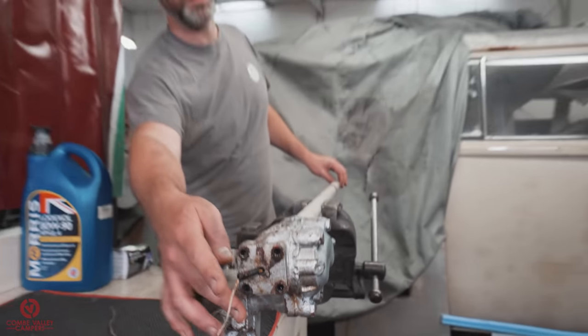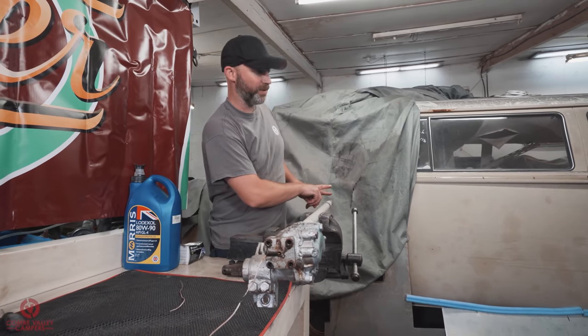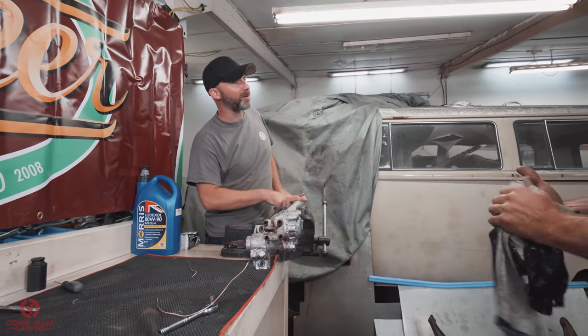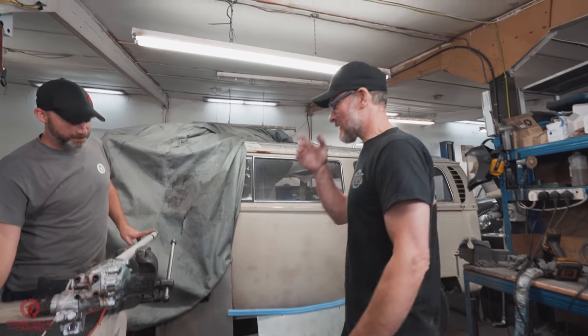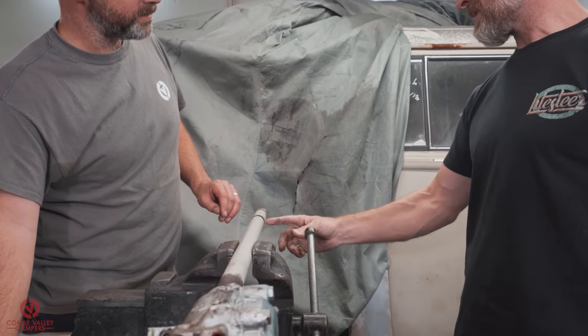So we're not actually going to replicate that, or we are? No, we're not, because your kit sits halfway up. But it's the fact that it's earthed from that horn push to the body of the motor, and then the motor's earthed to the... I can't quite remember now. It's been a while, Neil. So the motor unit is earthed itself. So the shaft will pick up its earth through the bearing of the motor.